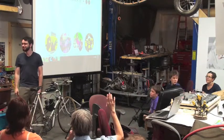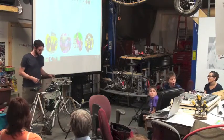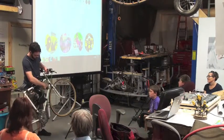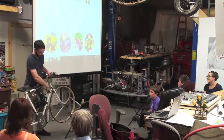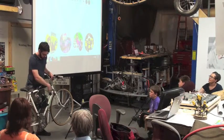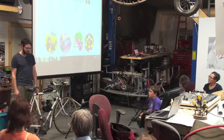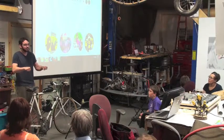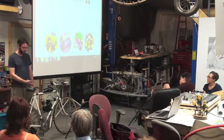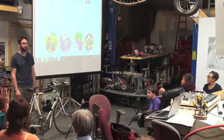Who wants one? What'd you say? Lock washers. They're on everything. So this part right here, if anybody else does want one, is called a capacitive discharge ignition, CDI, and this is made for a 4-stroke motor. Apparently China manufactures thousands of 4-stroke motors, but they send it with a 2-stroke motor. So after you get to about, I don't know, 5,000 RPM, the whole thing just starts shaking. So I ordered a different one that's actually made for a 2-stroke motor, and that's supposed to give you better gas mileage and more power.